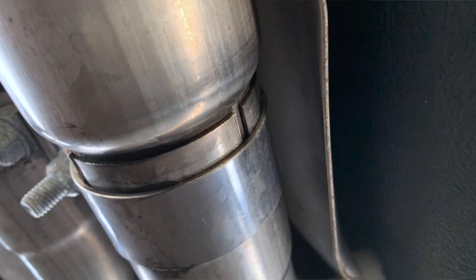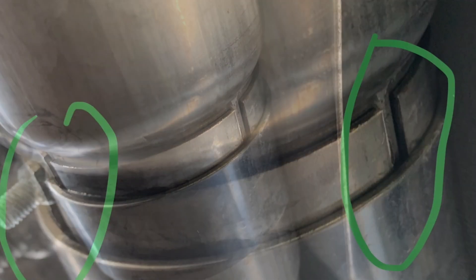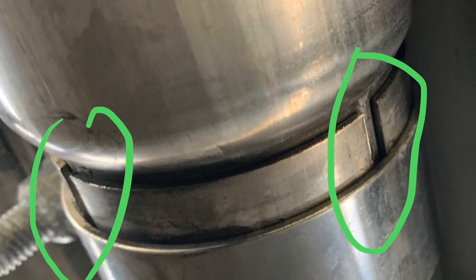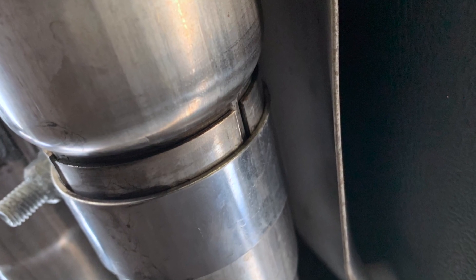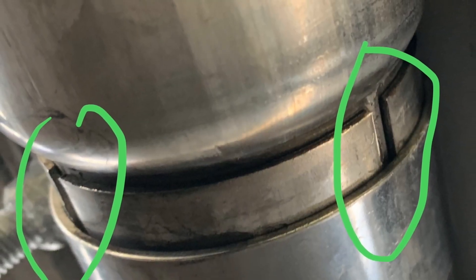The rattle is gone. I read somewhere in the forums that American Racing Headers told a customer one time with a similar symptom of rattling at certain RPMs to check the clamps. Because the entire clamp must cover as much of those openings in the joints, or the indentations, so that it is secured properly. It's not unusual for aftermarket exhaust components to come loose after all the heat, the movements, and the elements, so it's important to inspect it from time to time and tighten things up.